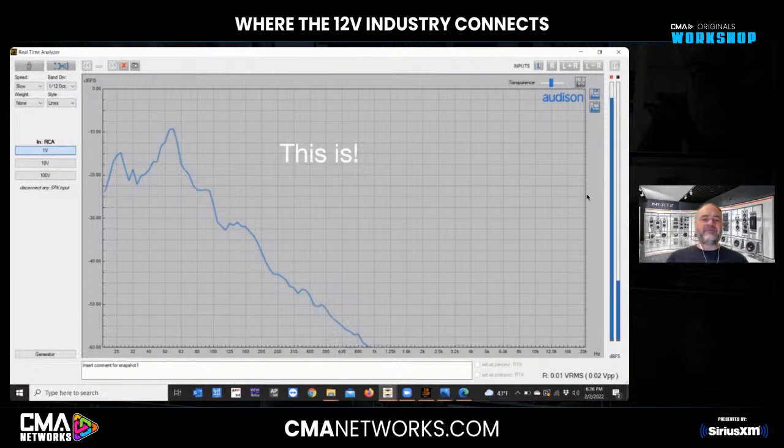There's a couple of different things you can do to make that subwoofer sound a little better. But if you're just adding a subwoofer, that might not be the goal of the user. They might just be looking for louder bass. They might not be looking for incredibly smooth or flat bass. But this is the correct wire. And so testing the wires will add a couple of minutes to the job. But that's nowhere near the amount of time you add to the job if you assemble the entire system with the wrong signal for what you need.